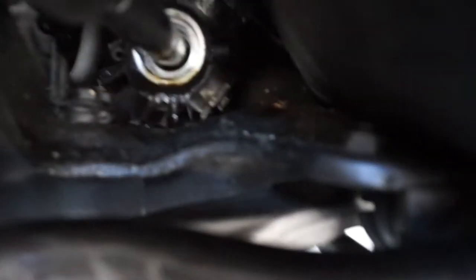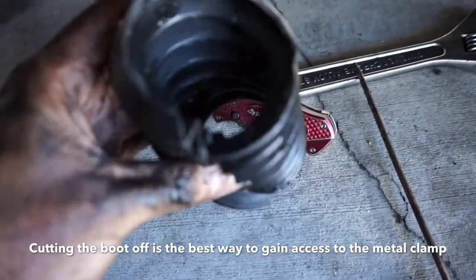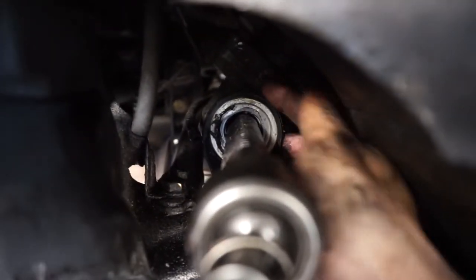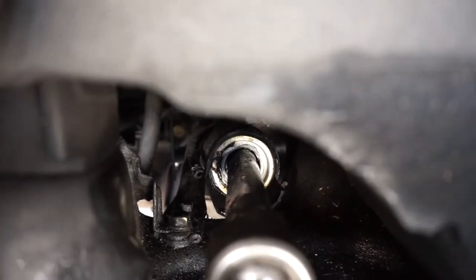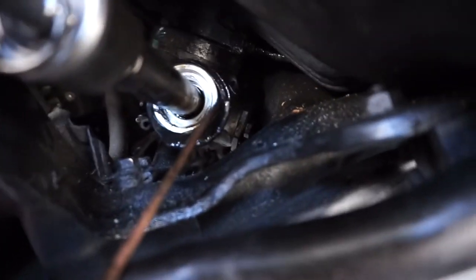To be completely honest, I've been going at this for about 10 to 15 minutes. I basically have to cut the boot out to gain better access. You can see that little air hose — when it compresses it pushes air to the other side because it's like an accordion. I have to slice it down and rip it off so I can actually feel the little locking part of the clamp.